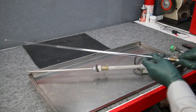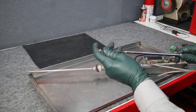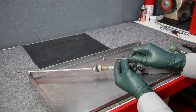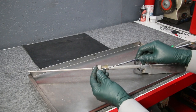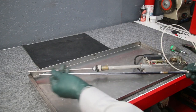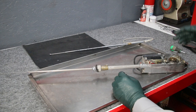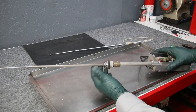If the mast is working properly, you should be able to push on the tail and have it go all the way out without stress, and pull it back in freely. This one is jamming up a little bit right in this area — it's frozen. I might be able to get some strong penetrant in there and let it soak overnight. One trick I've used is to soak these in hot water with electric dishwasher soap overnight — sometimes that loosens it up. This is a common problem from lack of lubrication.